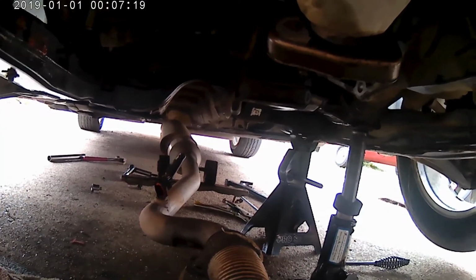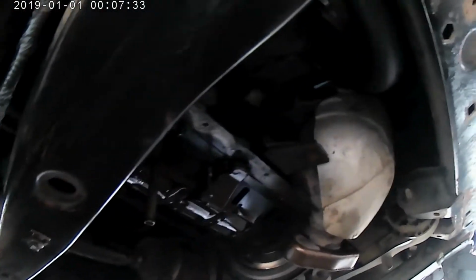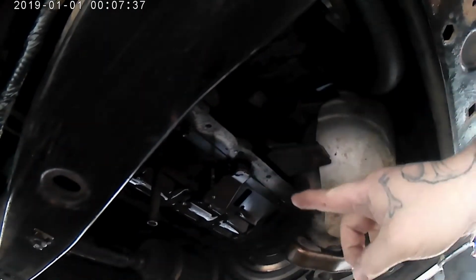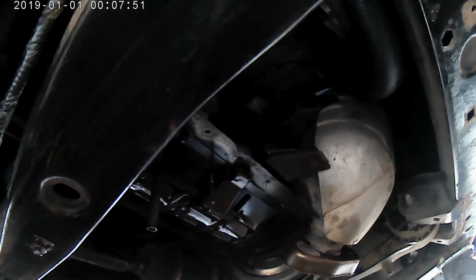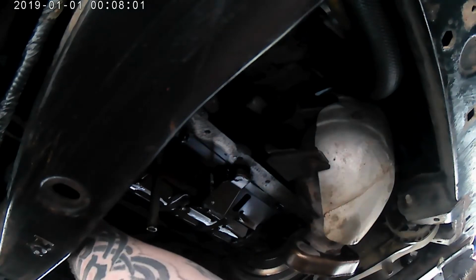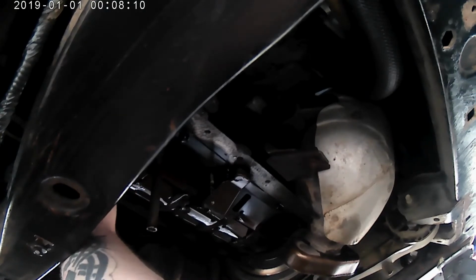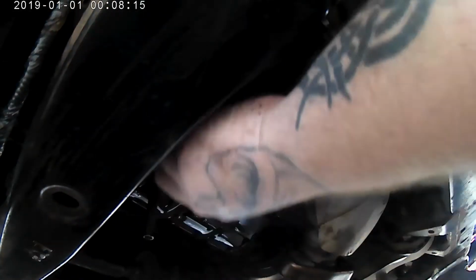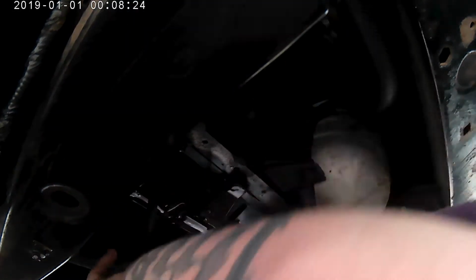So yeah, I'm going to go ahead and clean this mating surface and get it prepped and ready for some RTV sealant. Get this thing slapped in there right quick. So I'll try to set you guys up so you can see what I'm doing here. Right there is where the oil pan goes. I do believe that I've already got all the... No, I don't. Get all the RTV sealant off of it, and then clean up the oil. Oops, sorry guys. Elbow you. But we should be in good shape to go ahead and mate these two surfaces.